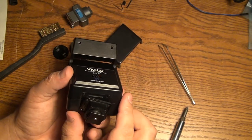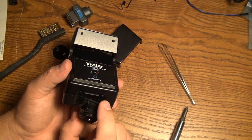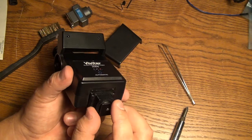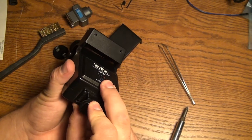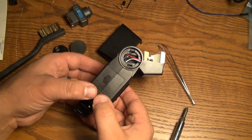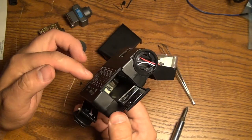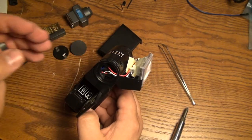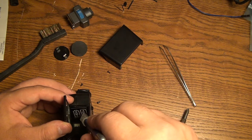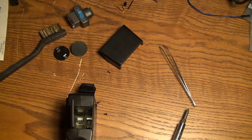Taking the four screws off the bottom, we find that Vivitar actually did a really nice touch with the attachment of the shoe — there's actually an indent like a recess that this fits into, so it's not just the screws that keep it from sliding around. Now that we've gotten those out, we undo the battery door. There are a couple of latches up here. There's also a set of stickers inside which show you how the batteries go, but the stickers are stuck across the separation of the case, so I have to use an exacto knife to cut them to open up the case.